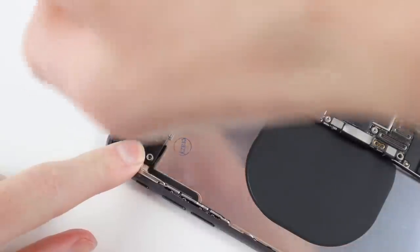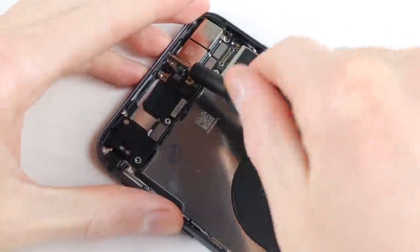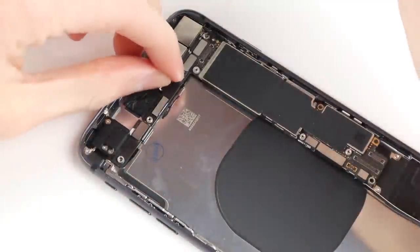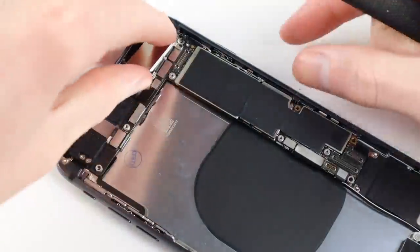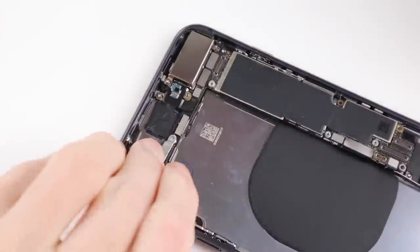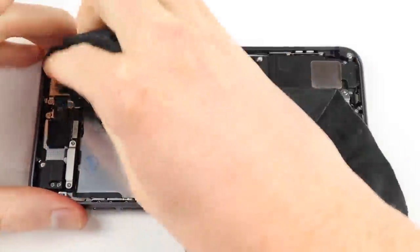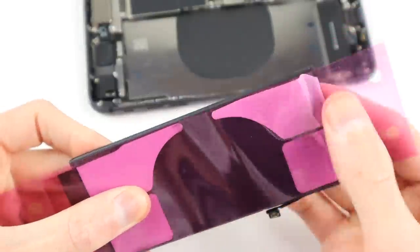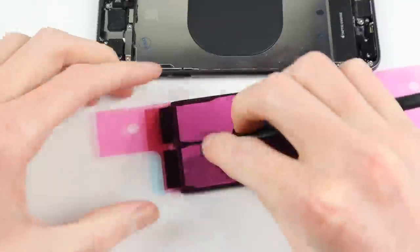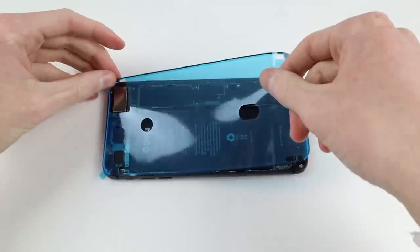I can install the WiFi antenna back up into the top left corner of the iPhone, but unfortunately I missed a standoff screw which I couldn't access with this little antenna here, so I had to remove the antenna itself and the camera bracket to be able to access that. But with a few screws everything was good to go. I can install the last few screws holding in the logic board and a couple of brackets, give the inside a bit of a clean, and it was time to prep the phone for a new battery. You can see here how the battery adhesive tabs actually go around the wireless charging coil so when you remove the battery you don't rip up the wireless charging coil.